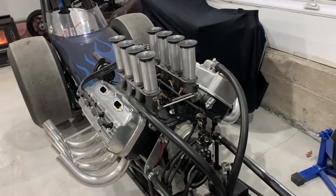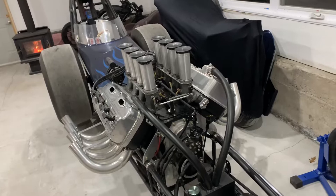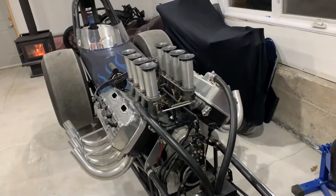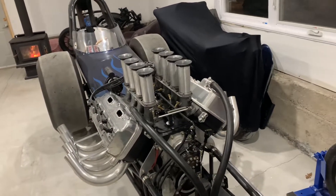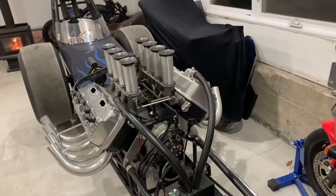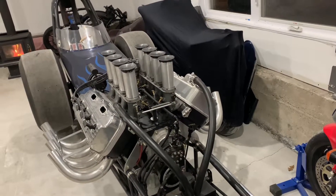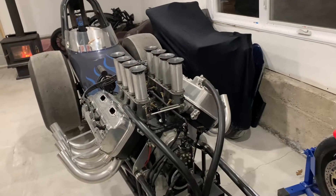The one problem with race gas in a motor set up for methanol is the valving — there's just too much race gas going in, so it'll run super rich. There'll be a little bit of black smoke for just a split second, but other than that it works really well.